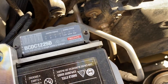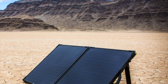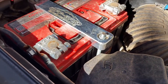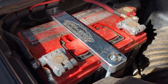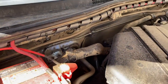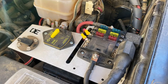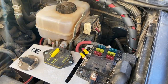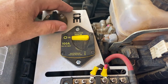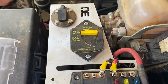This kit from Off Grid Engineering comes with a RedArc DC-DC charger, which feeds power to the second battery while you drive, and can also accept solar power when you're parked — brilliant for overlanders constantly on the move. Battery number two in the system is an Odyssey Extreme Group 35 unit that just barely fits on the passenger fender in front of the firewall. So far, it's provided more than enough power for the fridge on multiple 10-day trips, charging as we go. Power flows from this battery through a dedicated 100-amp breaker and into a small 6-circuit fuse panel. Right now we're only using the fridge circuit, but soon we'll have other loads to provide for. This fuse panel mount from Overland Expeditions conveniently had enough space to attach an Anderson port for our 100-watt solar panel to plug in, should we need any extra charging.